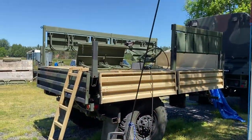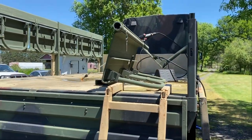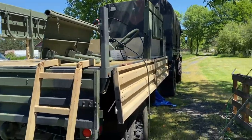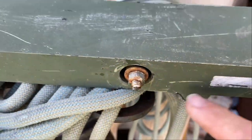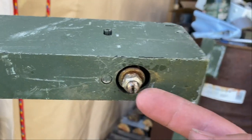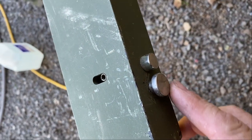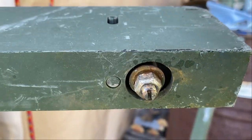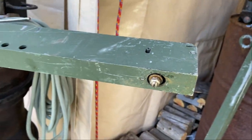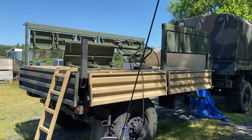Out of all of these that I have, I don't have the exact one to go into that right rear post. The ones with the handles in them are slightly different — the hardware is slightly different than the others. So what I've done is moved some hardware around and got the correct hardware. You can tell it's correct because it has that little split in the bolt and it has a head like this. You'll need a pair of vice grips or channel locks to put that on, and I went ahead and put some thread lock on it so it won't come out.